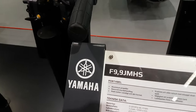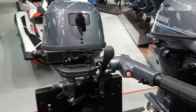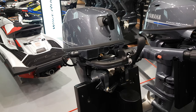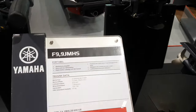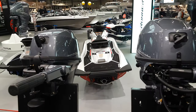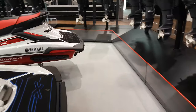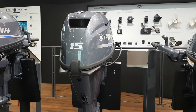We're also looking at outboard engines for the future. Right now we've just got a Mercury 6, but it's going to do for a few years. This is a 9.9 and that's a 25. Looking at the size of the engines, the 15 is going to be the last manageable engine that you can get off without any lifting gear - even that's going to be very difficult with the weight. The 9.9 is 41 kilos, the 15 is 56, and the 25 is 64 kilos. That's a lot of weight. Hopefully we're going to have davits on the boat by that point, so it's not going to be that much of a problem. I think it's most likely going to be the 15 just for the two of us.